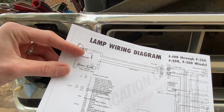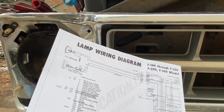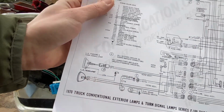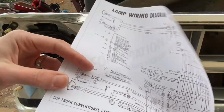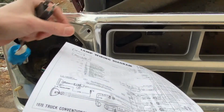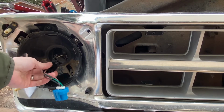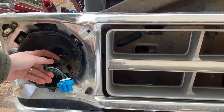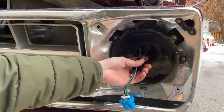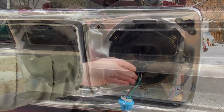Again, this is from the 1970, but we've got the ground wire, black 57 here, thinking of this as like the 3-prong like that, on this outside edge. And then, but on this side, 57 is on that opposite outside edge. There. But with my pickup, both of the black wires are on what I'm going to call this right hand outside edge there. Here's driver, black outside right hand edge going into black here, which draws into the middle.